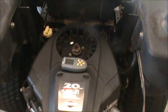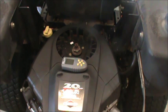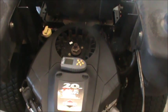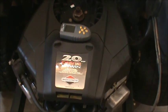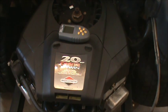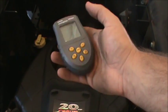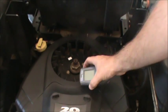As you can see, the engine sounds and runs really nice. The top end I have set at about 3300 and the bottom end is at 1500. I know this particular engine manufacturer specifies you can run it at 3650 for the top-end RPM. I wanted to mention this digital tachometer — it's the HS2234. I got it on Amazon about two months ago. It works really well and I used it a lot in this project, since it did take a little fiddling to get everything adjusted right.